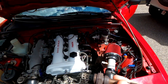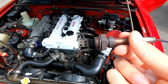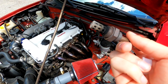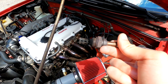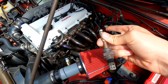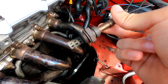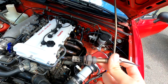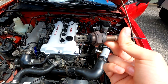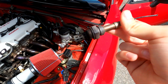Once your power and ground are hooked up, you can move on to installing your new O2 sensor. This will depend on where in your exhaust your O2 bung is, and whether you're putting a new bung in something like a custom downpipe. With mine, I put the new wideband O2 sensor in the bung in that Racing Beat header down there — this one just screwed right out and the new one went right in. Do note that since this is in the exhaust, they heat up a lot and could be pretty stuck and hard to get out.